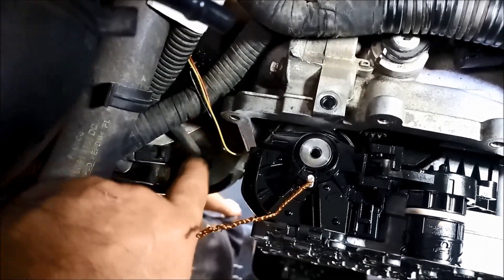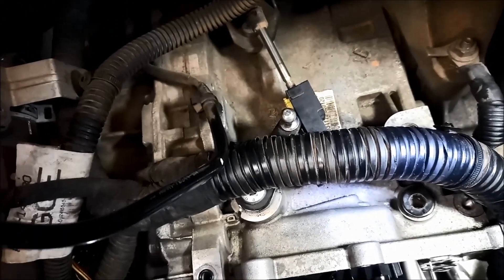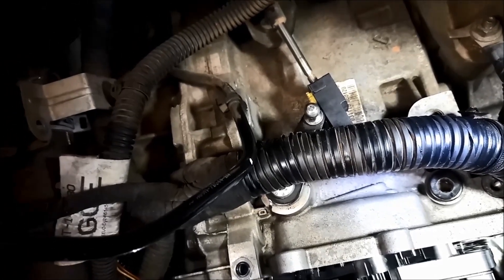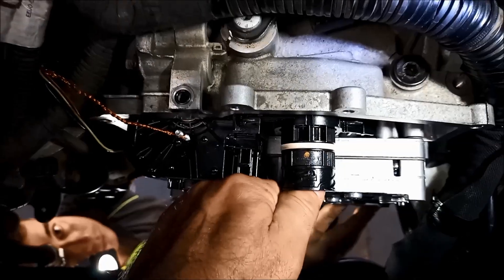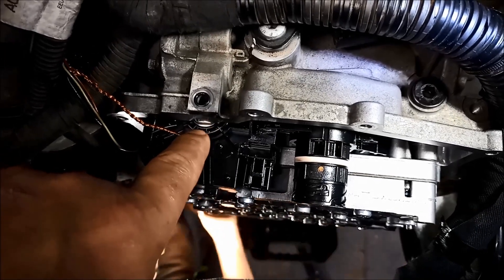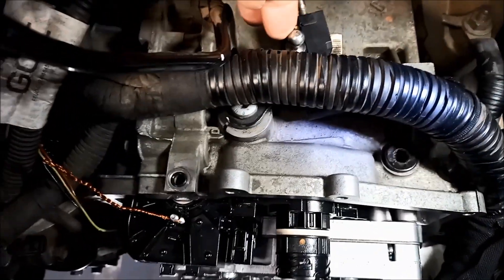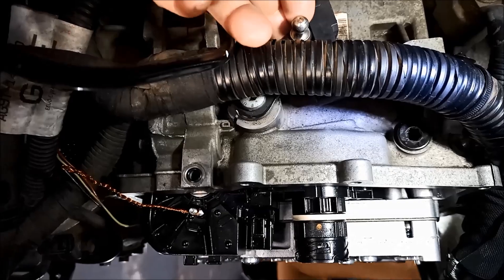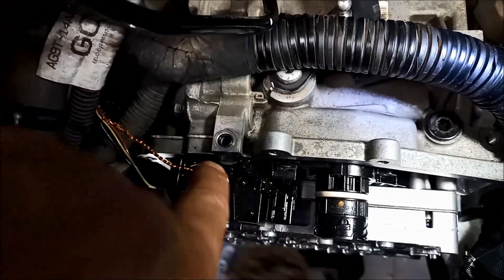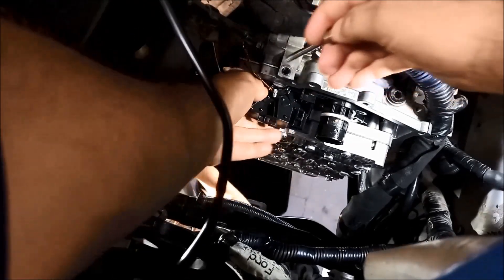Also make sure the range sensor cable — don't pinch that. Now this is all the way in at the pin. We're in drive, we've marked it, and now we just slowly slide that in like so. That should be lined up. When we pull this out it has got that little spring steel tooth section, so you might find you have to push this towards the front of the vehicle just slightly to release that pin easily.